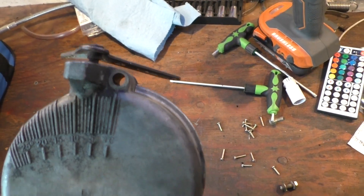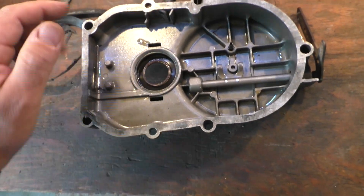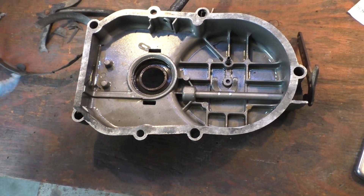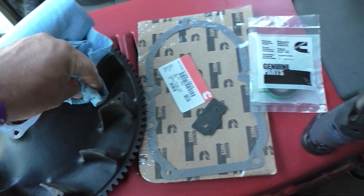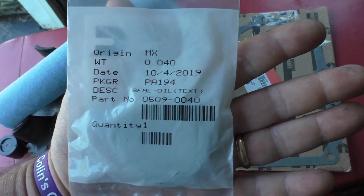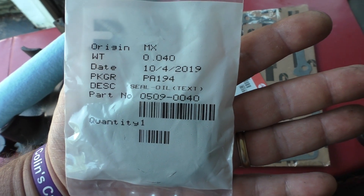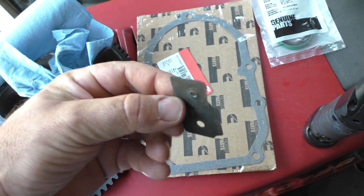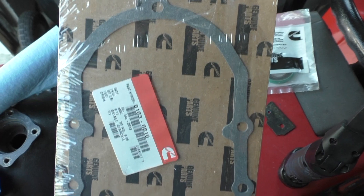There are two, four, six, seven bolts — one at the top. I'm going to knock this seal out just in case that was leaking too. I've got a new seal that came in the mail from owningparts.com — shipped real quick. From owning parts we've got some genuine Cummins parts here. This is the oil seal for the timing cover, part number 0509-000040.